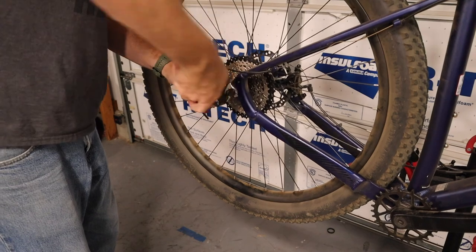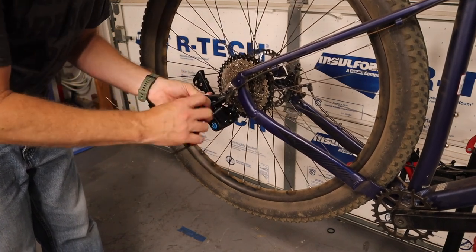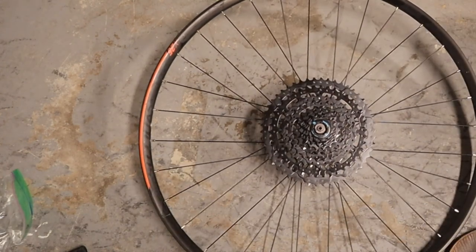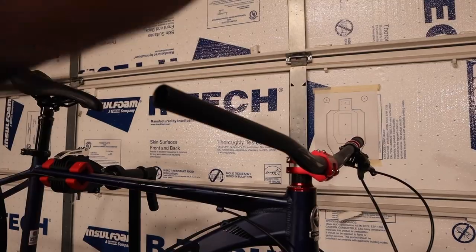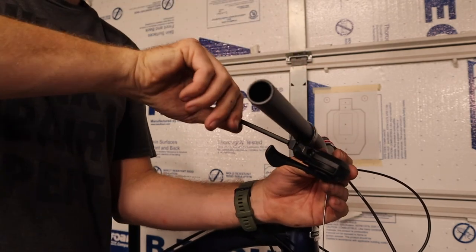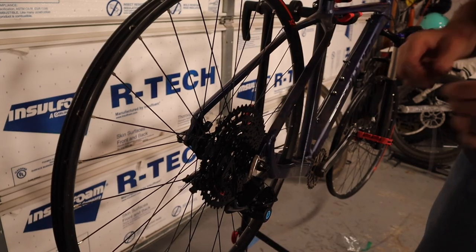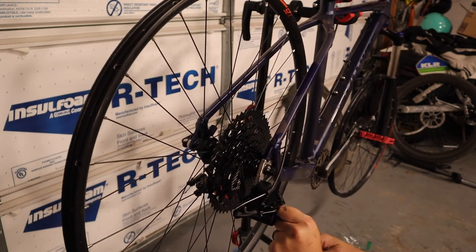With the chain out of the way, we can remove the derailleur and then install our new one from Box Components. With the derailleur installed, we turn our attention to the next step: installing the new cassette. For this you're going to need a cassette tool or cassette wrench — I have a link below to a complete toolkit that should have most of these tools. The next component to install is the shifter on the handlebar. This all came as a complete set from Box — much cheaper than Shimano or SRAM, and I've actually found the quality to be on par or better. Then we run the new cable down the length of the frame, reusing the old housings for an exact fit, running it all the way into the derailleur.